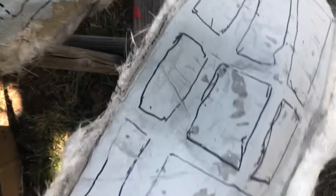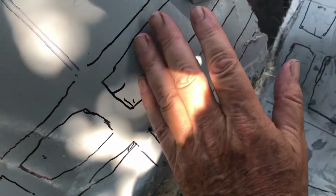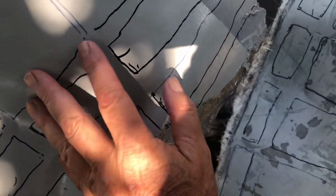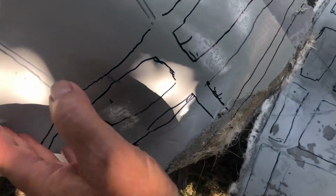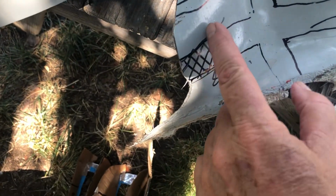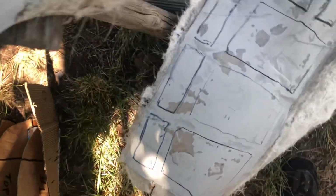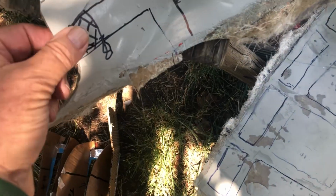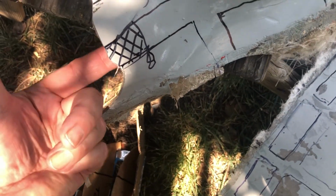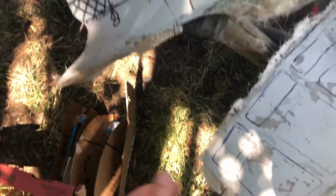put it there. Now the key is this part right through here is accurate because it's from the car we built last year, and we spent a lot of time making the two sides match. Again, though, I had to cut off where the turn signal is, so this area has to come out. When I put this on here, the reason I did the openings was to see where this thing interferes, and I found out this comes out too far. It needs to be straight across there.